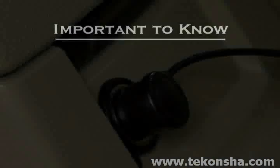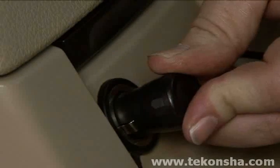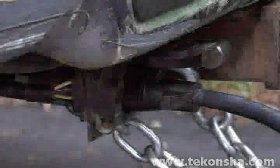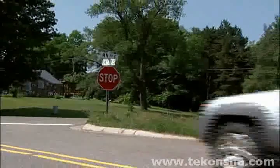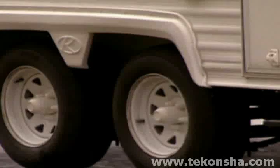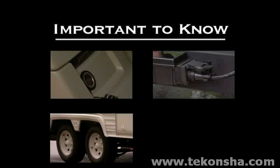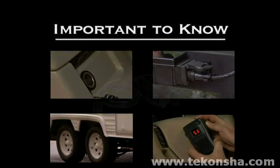It is important to know that the Prodigy RF will still work and apply your trailer's brakes if the remote handheld unit is accidentally disconnected from the 12-volt auxiliary port. It is the power supplied through the 7-way vehicle connection and the sensor located in the trailer-mounted module that actuate the trailer brakes, not the radio frequency used to set the proper power level at the beginning of your trip, nor the return signal that indicates your braking status. If by chance your handheld unit does become disconnected, the trailer brakes will be applied according to the last delivery power command sent from the handheld unit.